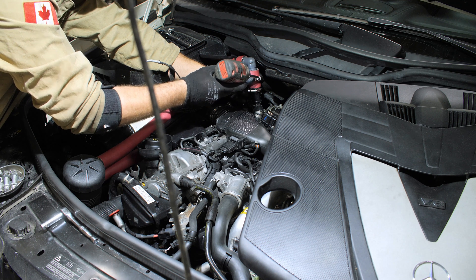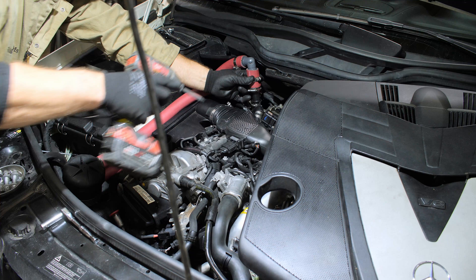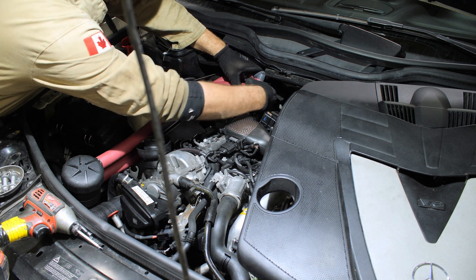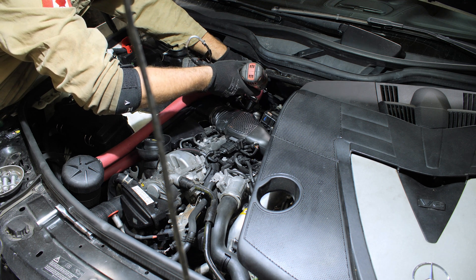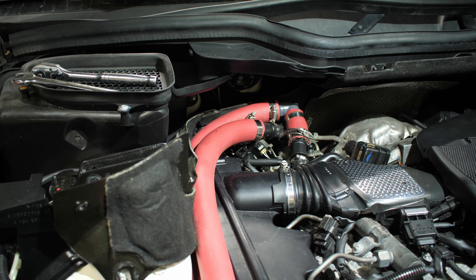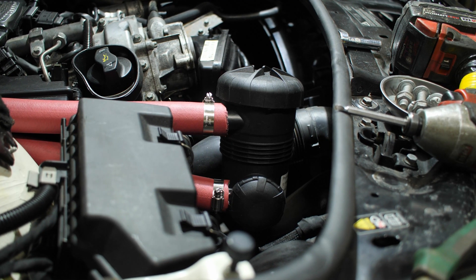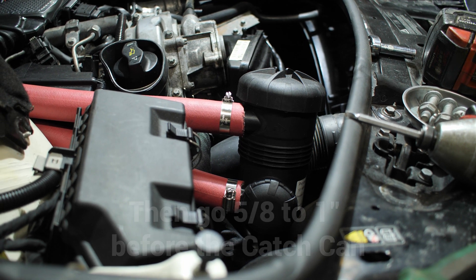It's a bit of a tight fit and I may end up changing it, but for me I don't really care what these mods look like. If you're one of those guys who needs a super clean install, you might want to really think about your plumbing. I was able to tuck that 90 underneath there — this was definitely the trickiest part of the whole install, just figuring out how to get these hoses routed nicely. In my opinion it doesn't look too bad — kind of Frankenstein-ish. You could actually just go 5/8-to-5/8, find some oil-resistant hose, and keep it all 5/8 — that would definitely reduce the amount of giant hose you've got in there.